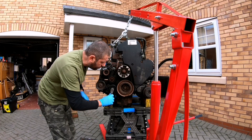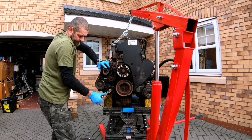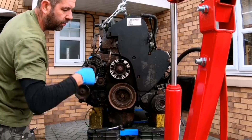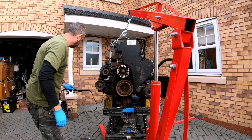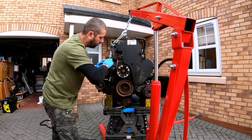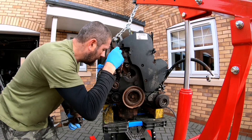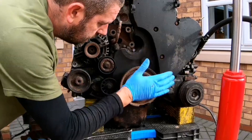First thing, I want to remove the serpentine belt. I've already removed the cooling fan — snapped a couple of bolts in there — so the next stage to gain access to the cover is to remove the cooling fan bracket mounting bracket. That's the cooling fan mounting bracket removed.